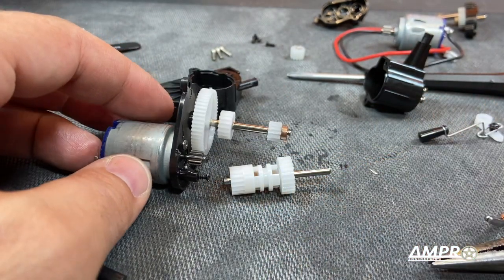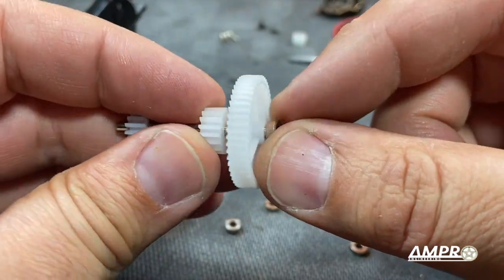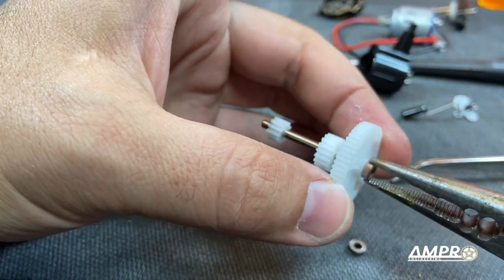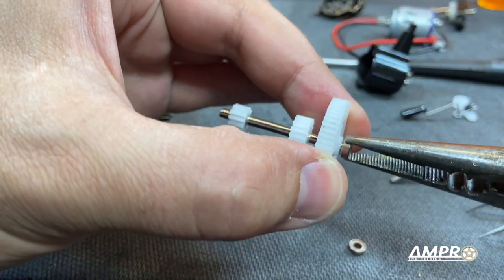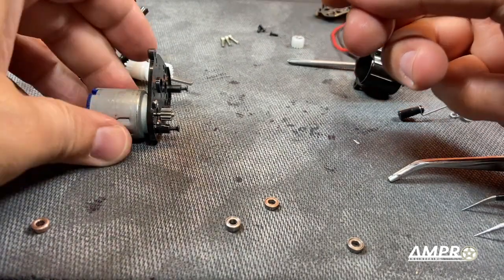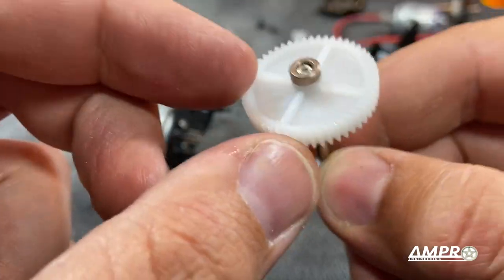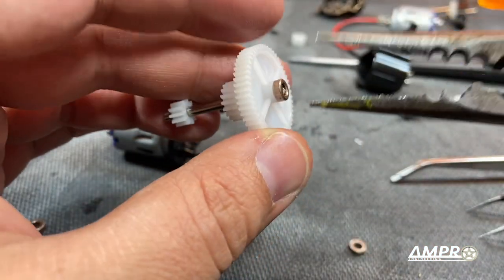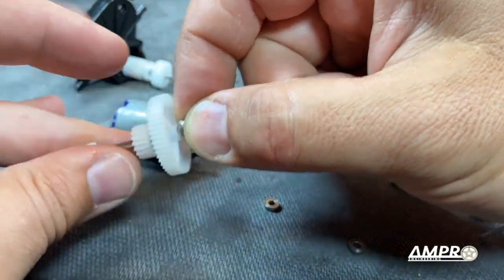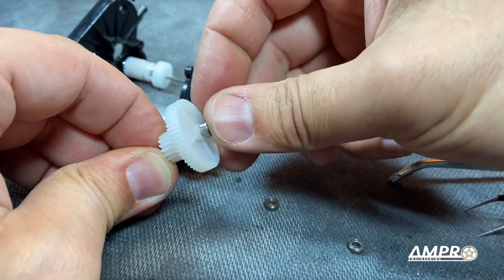In my application, I am going to replace these with bearings — link to those is in the description. I want to show you something real fast. This is the bushing I just took off of this side. I'm going to put it back on and try and spin the spur — it's not spinning easily. This means that when this bushing was pushed in, it was pressed on, and bushings should not be pressed on. When this was rotating, the bushing on the outside was spinning — you can even see the wear on it. That's not how bushings work. Bushings are designed for metal-to-metal contact, not metal to plastic. Plastic gets hot and melts over time, so eventually this bore will just hollow out. So we have to put a bearing there; otherwise it's just going to eat itself.